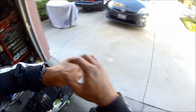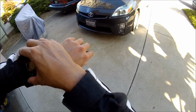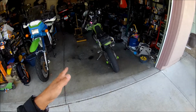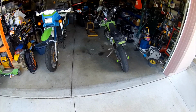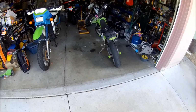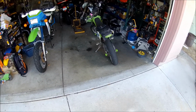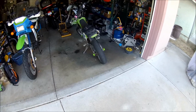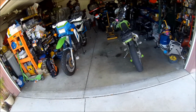Yeah. So anyway, that was it. I got it to a full hour, man. We've been out here an hour. So hour and 1 minute so far. We're probably gonna let it idle for 5 more minutes, and then we're gonna kill it, and that'll be it for today. The bike ran pretty good. I noticed it doesn't want to idle sometimes. I keep on adjusting the idle screw, more open.